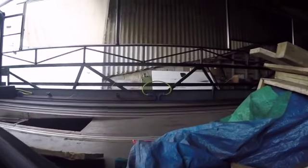We reckon about six months of work to go. Here you can quite clearly see where we've raised the roof — we cut a section of the roof out because we don't want a step, we want a slope — and we've moved our windows back. I don't think there's anything that's the same. The original bodywork below the windowsill is the thick bar; our thin bar is flat steel on top. The original was two millimetre thick box steel, mild steel, 50 by 40. What we've put in instead is 50 by 25 but in three millimetre box steel — a little bit tougher. The diagonals are 25 millimetre square; everything we're doing is in three millimetre steel. The cab has stayed the same.